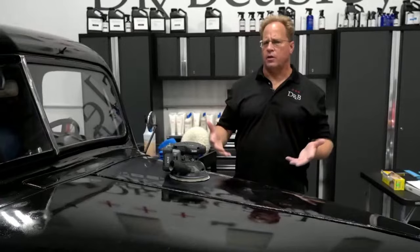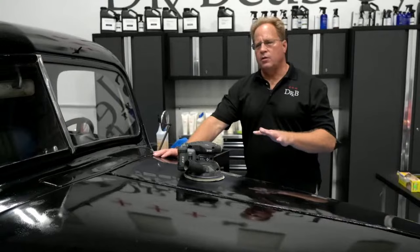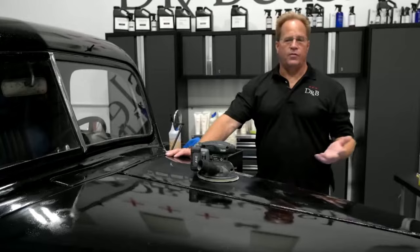And in today's modern world, I think in the Eagle abrasives line, the highest they go up to is 2,500 or 3,000. They might go to 4,000. But in the 3M line, you can go to 8,000. So I always tell people, let your budget be your guide, okay? If it's your project and you've got unlimited funds, sand out to 8,000, then start buffing. If you're on a budget, then maybe finish out at 2,000.